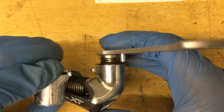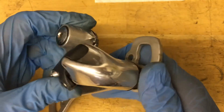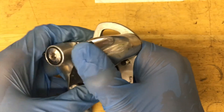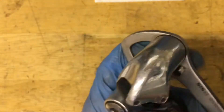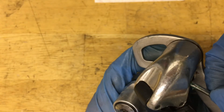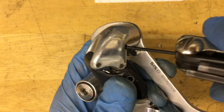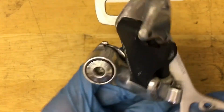Once you feel it goes all the way down, rotate it around in this direction, then push it down. Now screw in the 2mm pinch bolt. Make sure the cage is all the way down, then grease it up a little bit and screw it in. Screw it all the way in — you don't have to cinch it down too much and you're good to go.